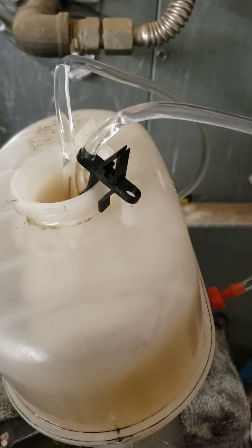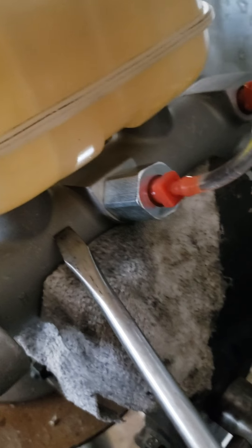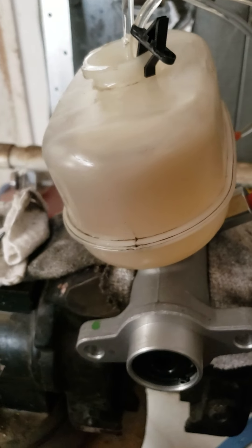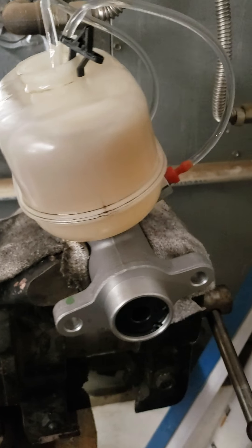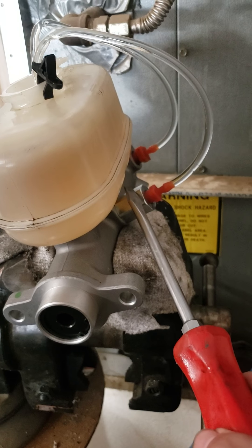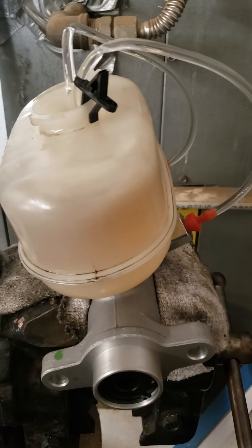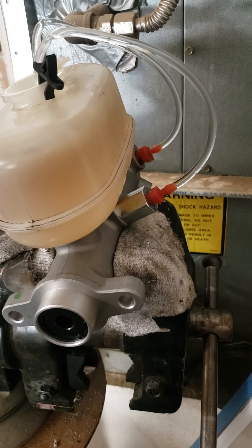When you don't see any air, you know there's no air in this housing. I'm going to leave these fittings on until I remount this master cylinder — it's underneath the cab behind the driver's tire, kind of a pain to get to. The brake lines will connect right next to where they mount, so I won't lose much fluid. I'll put the cap back on after, and I really shouldn't have to bleed the lines at each wheel cylinder or caliper.